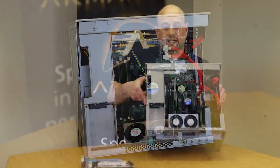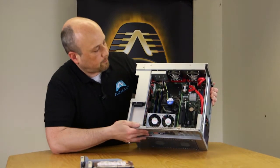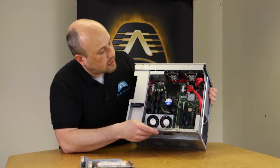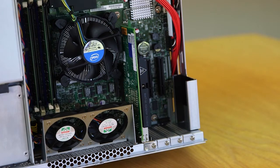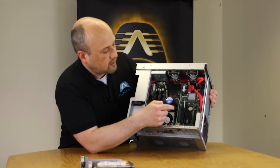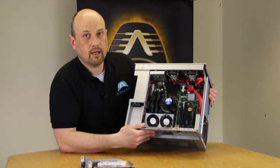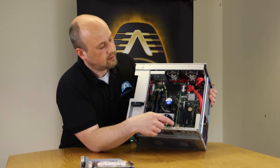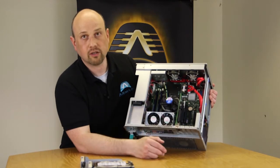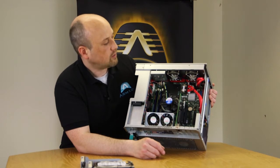Inside, we have the Intel Micro ATX server board with 4 PCI Express expansion slots, up to 3 of which are Gen 3. It features a clever three-way Gen 3 PCI Express switch that can direct the 16 lanes from the processor appropriately between the RAID module and expansion slots — allowing all five connections off a single motherboard, which is quite rare.